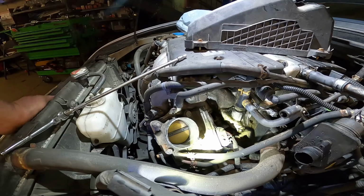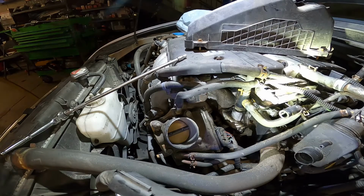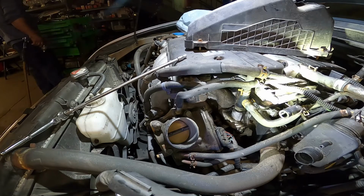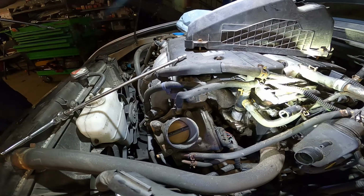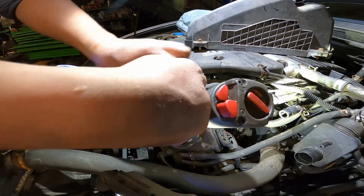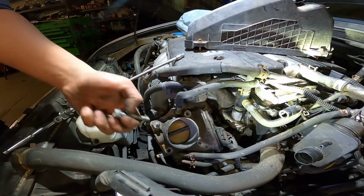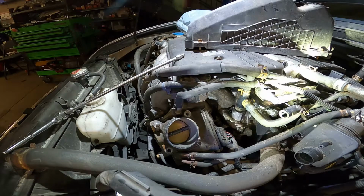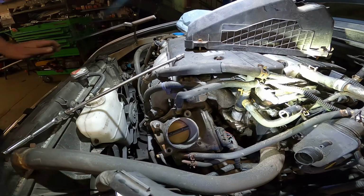Okay, just leave it on the side. Then I'm going to clean the throttle body for him a little bit. Let me bring my tool to do it. Yeah, try to help him out a little bit, you know, it's an old car. This is number 12, okay, number 12 millimeter. So remove those 2 screws and 2 bolts out, so it's free.